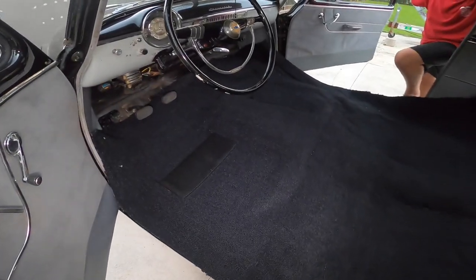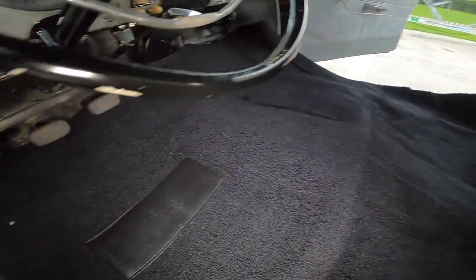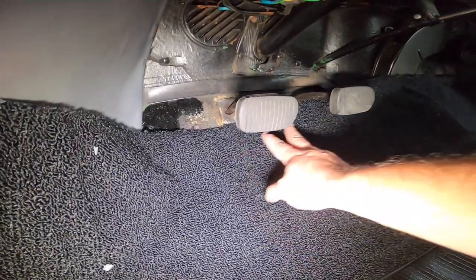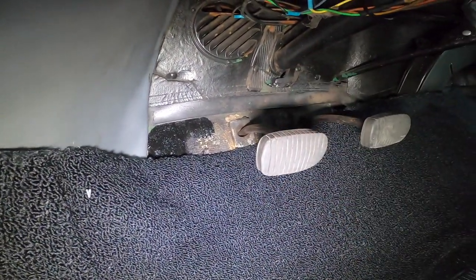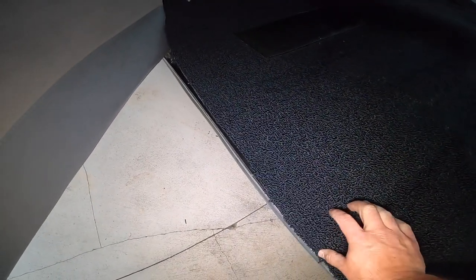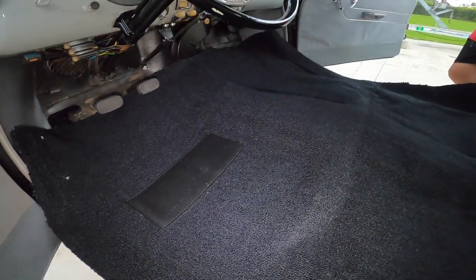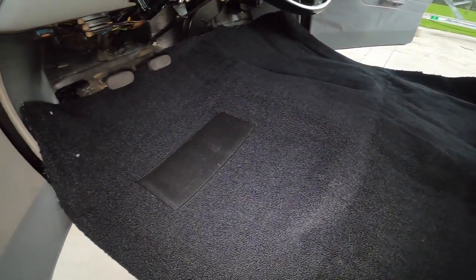The black carpet is already laid out on the floor. This carpet doesn't come fitted for the car — you have to make some cuts and adjustments. For example, the holes for the seat you have to drill. I'm going to go underneath the car and with a drill from the bottom up I'm going to make the holes. Over here for the clutch, the brakes, and the gas pedal I have to cut so I can bring the carpet up to the firewall. On the sides I also have to cut so that I can fit the panels. We have to be very detailed when it comes to cutting and drilling because we don't want to ruin the carpet.